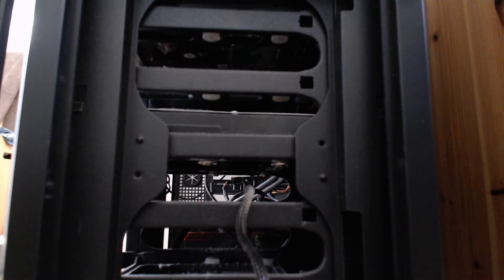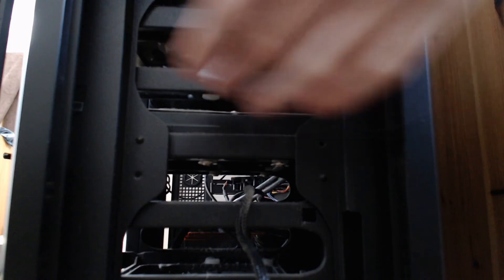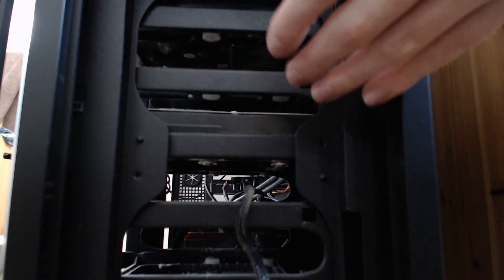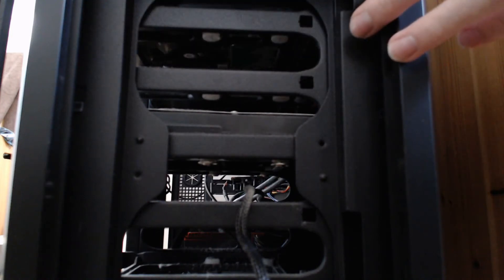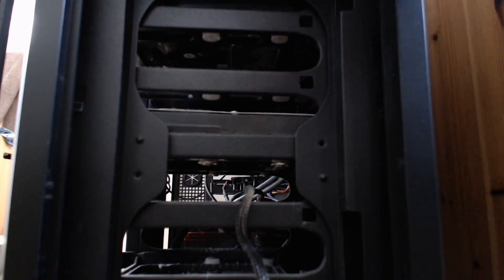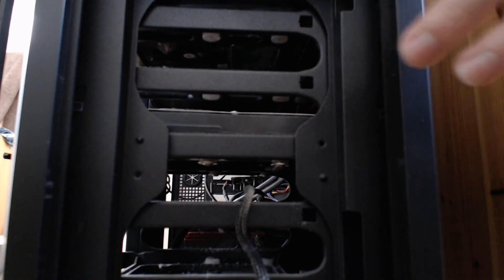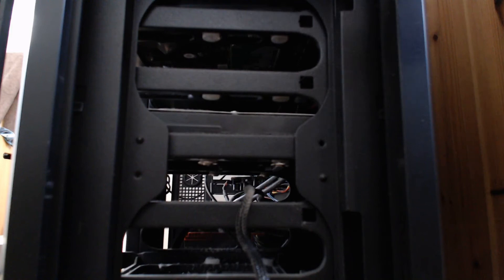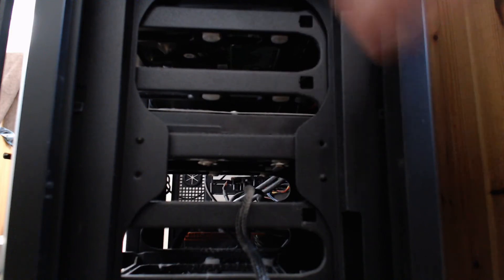So this is the front intake of the computer, and there are two fans behind the hard drive bay sucking in cool air from the outside. So obviously the first two hard drives are going to be in the firing line of this cool air, meaning they're going to stay cooler, whereas the top bay isn't in this path of fresh air so you're not going to get the cooling effect on your top hard drive. If you're a server user and you want your hard drives to be cool to make sure they last the longest they possibly can, it's something that needs to be considered.